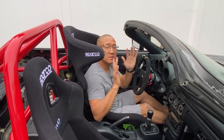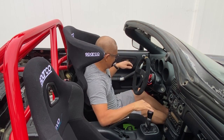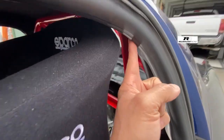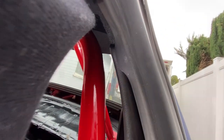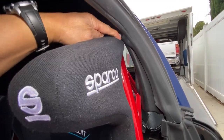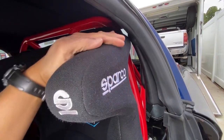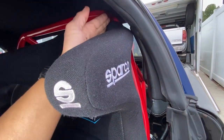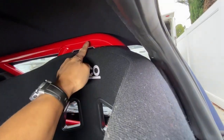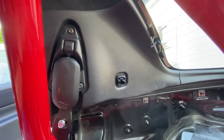Next we're going to stick the hard top on and see how this thing is affected. It doesn't hit here but it does barely touch this piece of plastic on the inside right there. It barely touches it. Keep in mind if you don't have a halo this section won't be here. Your main obstruction will be the main roll hoop right back here. There are three attachment points to the hard top: the front latches, the rear hooks, and the third one on the inside.